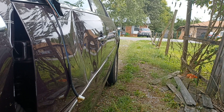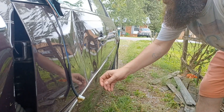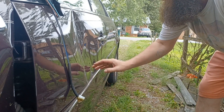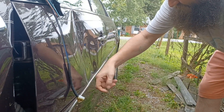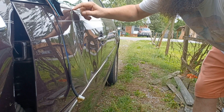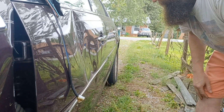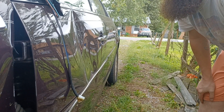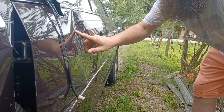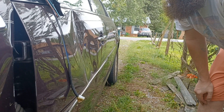We're going to move on to the door now. It appears we've got actually what seems to be three creases — one dent going down here and kind of a separate dent here. They sort of transitioned into each other right there. Looks like a branch hit here and dragged down really hard and came off there. So we're going to try to get some compression out of here. Up here is going to be difficult because I need to tap it down right on the very top and I'm going to hit that trim. We'll try to get some compression out right there, which is just barely above this trim, and then we'll put some hot glue. We might start here because that's got that crease in the body line just like the fender had.